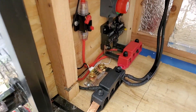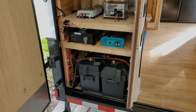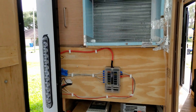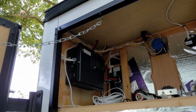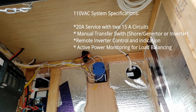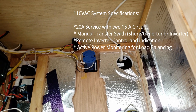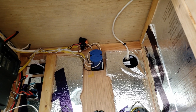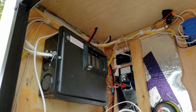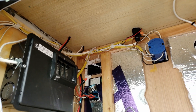I'll put the batteries in and come back, but I wanted to show you how the bus bars are set up in here. So I got all the battery back in now and I'm just going to give you a show of everything. Starting at the top - this is the AC section. The blue thing is a transfer switch that I got wired up. It transfers between the shore and generator and the inverter. The top right is the back side of the meters. This is the 20 amp main breaker there with two breakers: one for the air conditioner by itself and one for the rest of the trailer. That's the AC section up there.